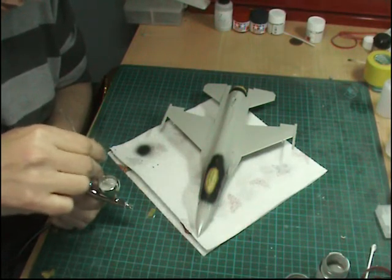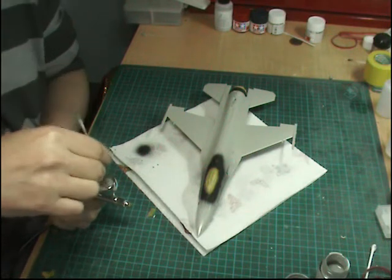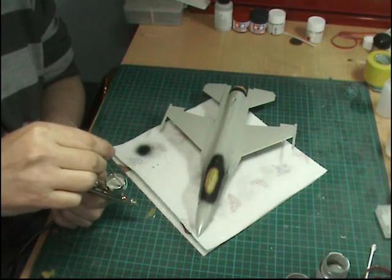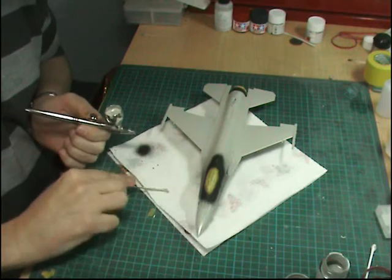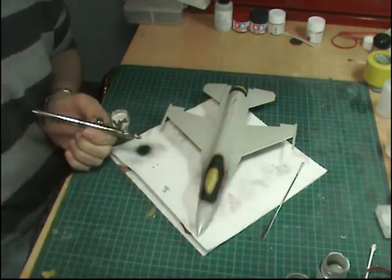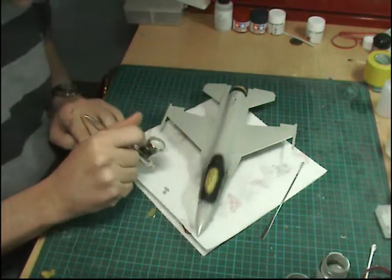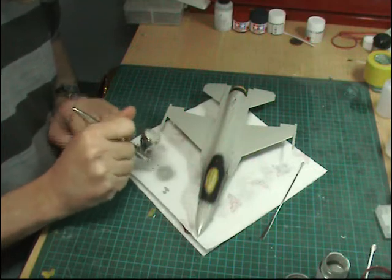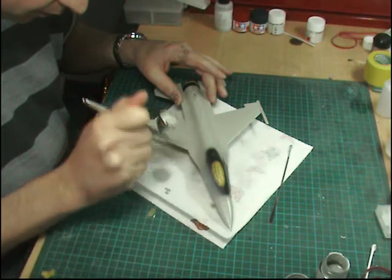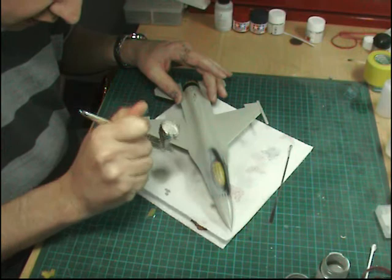Give that a very good mix and get the colour cut all the way around. Run at a medium sort of air pressure, about 20–25 PSI. If your paint starts to spit, it might be worth turning it up a little bit. Keep the compressor on because we've got a nice flow. We're going to cover up this black, so we're just going to lightly spray it on everywhere.